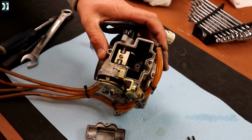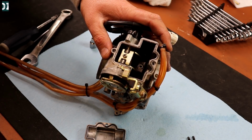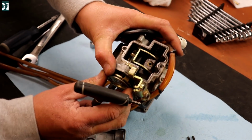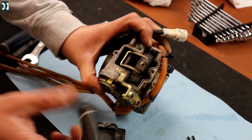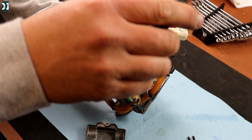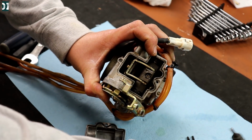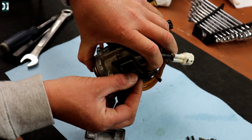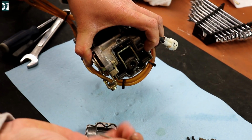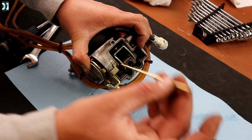So to get into the needle, you need to remove the cover and then get an Allen. Bring the slider to the top. Dallas, you can bring it to the top. And you see there's a little Allen, you take it out and turn it upside down and the needle comes out. Catch the spring. The blue one? Yeah, blue one, second clip, so that's where it is right now.